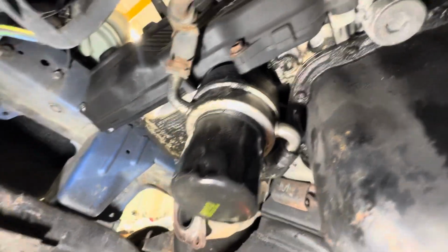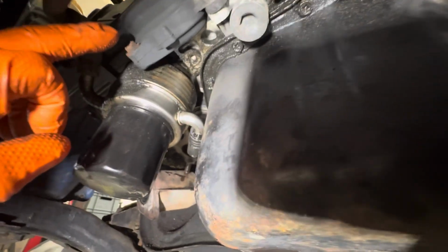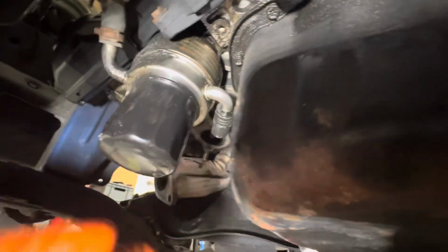Now, while that's there, you can see my water pipe here is a bit corroded, and for around 30 quid you get a new pipe and the 3 new tiny little 90 bend hoses, and this one's got a heat shield on it. So I'm going to buy the new seal for here, which is 6 quid. Obviously I'm doing an oil and filter change anyway, so that's fine, and we'll spend the 30 quid and change them hoses.